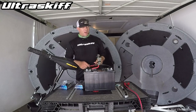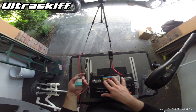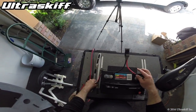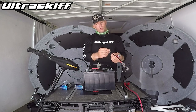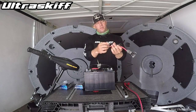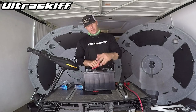So really quick — with this one, all I did was use 5/16ths ring terminals. I just cut them, spliced it, crimped the ring terminal to that, put some liquid electrical tape — or what's even better is if you find ring terminals that have heat shrink tubing attached to them, then you can just heat shrink them right onto these wires. It's a great setup right there.